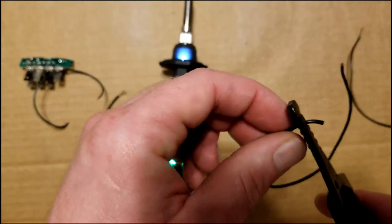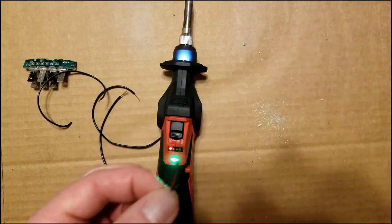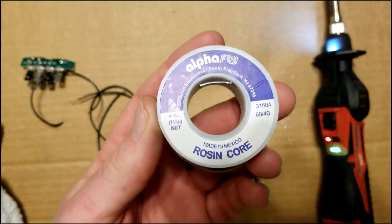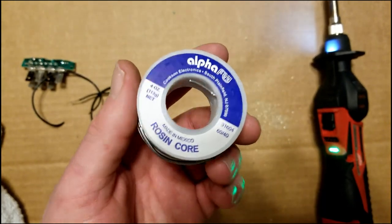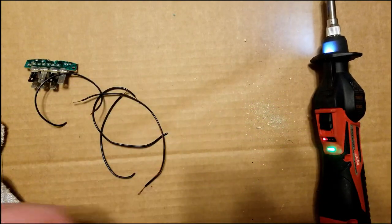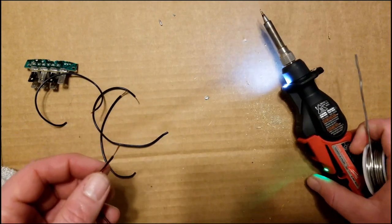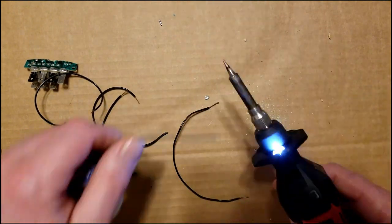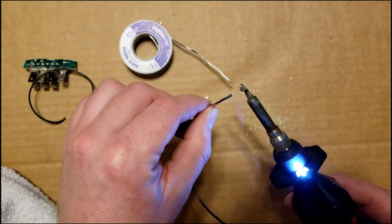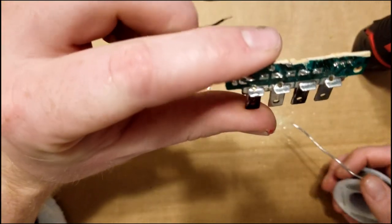And we're probably going to trim these down. We don't have a lot of room to work with, so we want to keep it as clear as we can. You want to make sure you're using a rosin core solder. There's going to be links in the description to all the supplies that you're going to need. The thinner, the better for this. And we're going to pre-tin the ends of all these wires. And now we're going to do the same thing on the holes we made over here.